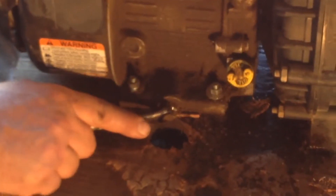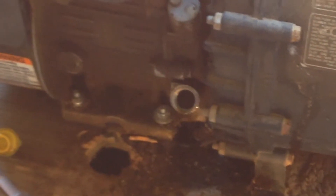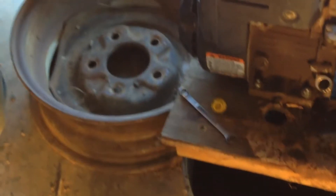We are using a 3/8 wrench. Now I'm just going to pop that loose. I'm going to try not to drop that plug into the hole, or into the oil, because I've done it 72,000 times before. I'm going to pop this out so it happens a little faster. Now I don't run my oil real dark — if it's going to last, you can't run it real dark.